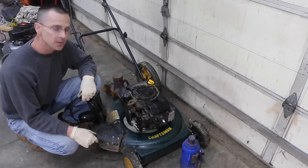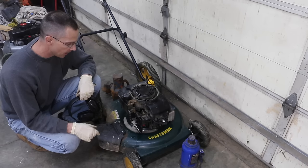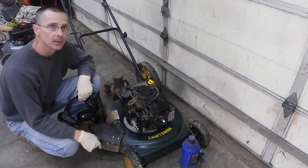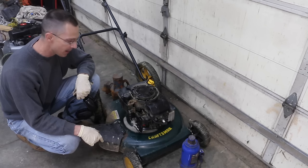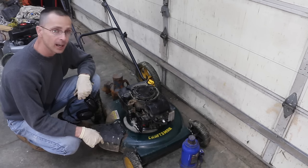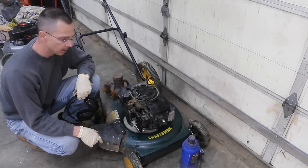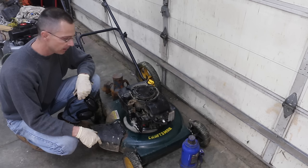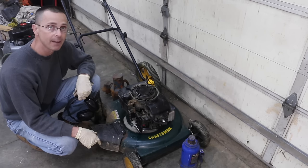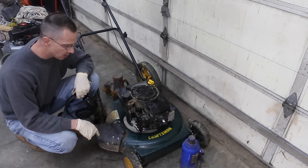It's been about two hours of slow dripping of water into this engine. As you can see, we have some blow-by — it looks like we have some water that's mixed in with some oil, and it's starting to come out of the carburetor. This is an unfortunate turn of events. I fed the water extremely slow — about two hours for not even a gallon of water. I had to add fuel a couple of times. And as you can see, this is the risk you have of using water. I did not anticipate this result.